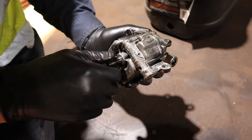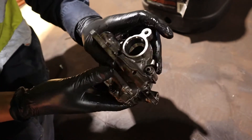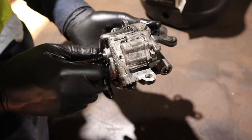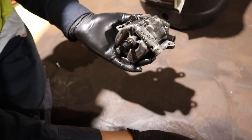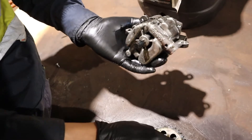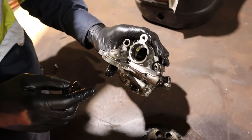Looking at the old oil pump — when you go to spin it, you can only spin it so far before it locks up. It has actually broken the vanes and all the internals. You can also see it's cracked the oil pump housing; because it locked up, that's why the sprocket fell off. We'll open it up and show you what it looks like on the inside.